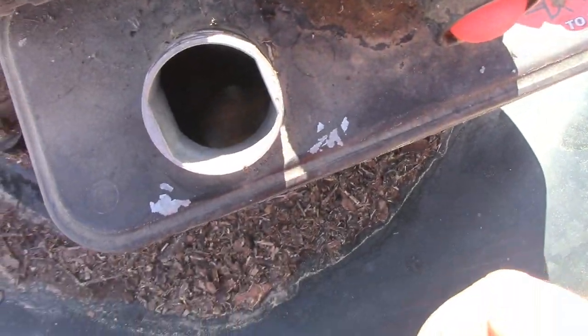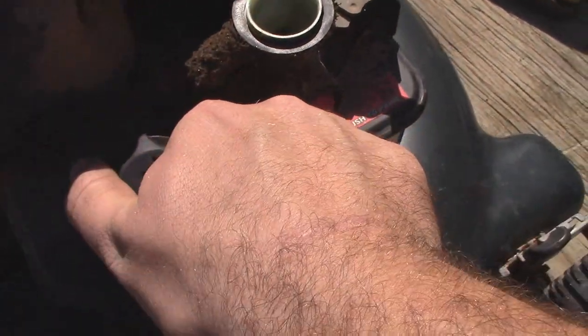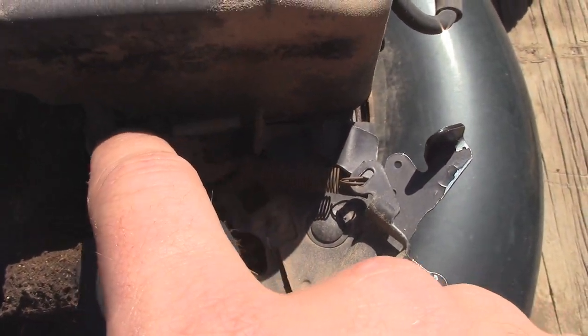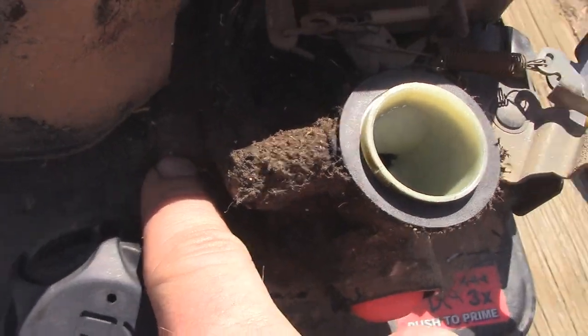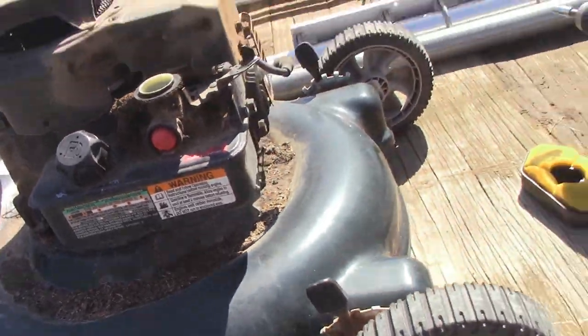The first thing I'm going to do is drain all the old gas out of it — that could be where some of the issues are coming from. Very simple to remove these tanks. We'll have to remove this metal linkage as well as these two springs, and then there's a 1.5-inch bolt right here and a 3/8-inch bolt right there. We'll go ahead and remove those and get on with it.